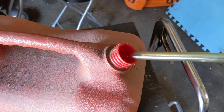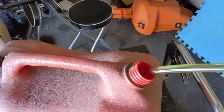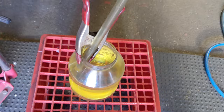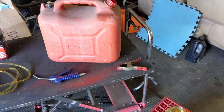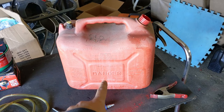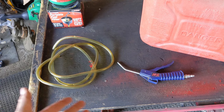I'll quickly show you how this one works. You lift it up and down until the fuel starts to drain into your line, and this one goes pretty quick because the diameter is larger. If you want it to stop, just lift the tube up, it starts to suck air, and that's it. You can see just how quickly that one filled because of the larger diameter — that's one reason I prefer the smaller diameter, it's a little slower and more controllable. Even though it fills jars quicker, you're limited by the length of the tubing. With the air gun and rubber tubing method, you could use 10 or 20 feet of tubing if you needed to drain fuel from a tank farther away — on a farm, for example. This technique is tried, tested, and works, and I just wanted to share it.